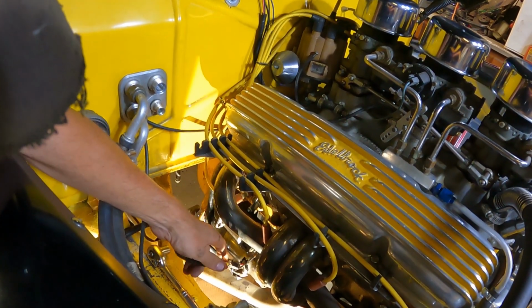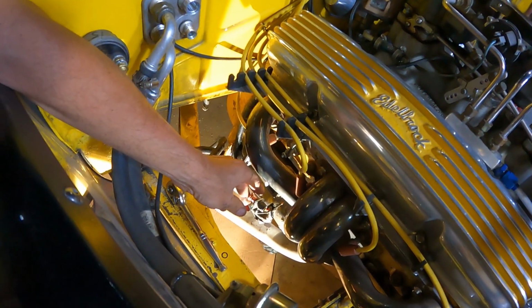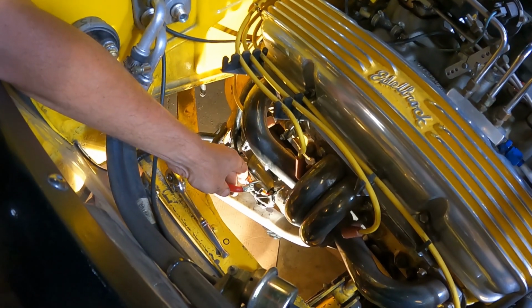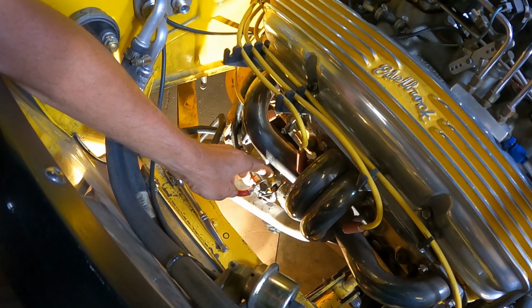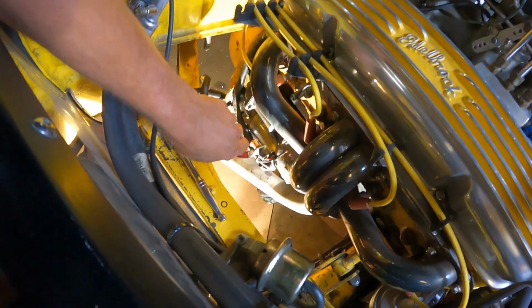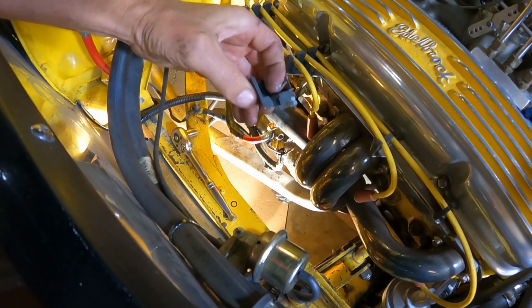But the problem is, it had a little half-size nut which stripped out on the stud, so I was threading a nylock nut on there to hold everything together. And the threads, because it got stripped, left a burr, and it bound up. And I thought I could tighten through it. Well, I broke the solenoid right off there. Bam, look at that.